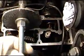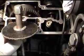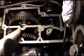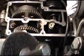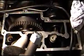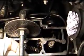I ended up sealing the bottom of the engine off and having a vacuum set up. So this used the same bearings. It used the bearing here and the one through here that the sprag clutch shaft goes through. And I'll put the nut on from this side here. Thread it all the way in. It fits through that bearing without an issue. And then it spins freely in here.